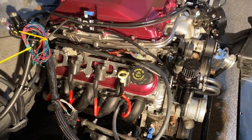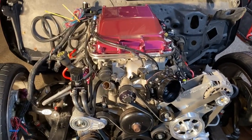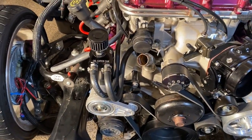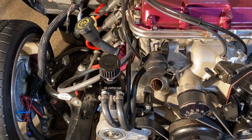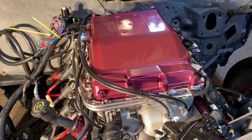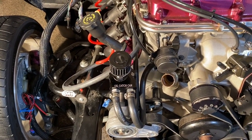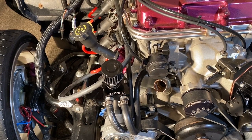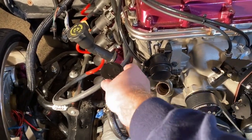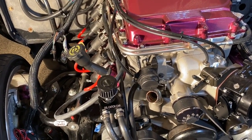I should be okay for now until I get the intake sorted, which I'm not quite sure when that's going to be. One thing I didn't mention on the whiteboard — I did put the breather on this. I know a lot of people say they don't do it because it spews oil all over their engine bay, but I put it there as a safeguard in case there's too much pressure in the crankcase. I don't want to blow out any rear main seals or have oil leaking out the valve cover gaskets. So I put it right there as a fail safe. If I notice it starts blowing too much oil out and coating stuff in the engine bay, I'll either take it out or wrap it in some type of cloth and make changing that cloth a regular maintenance deal.